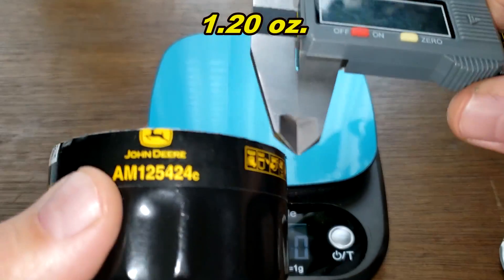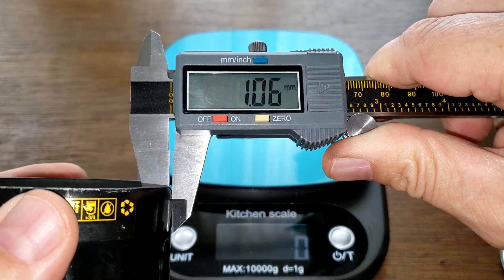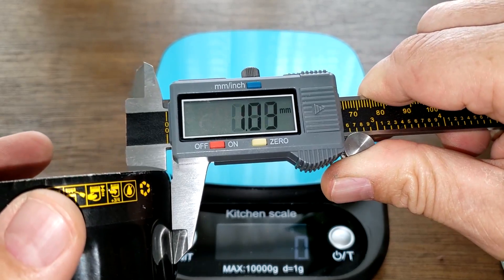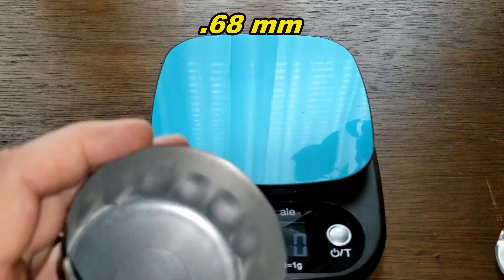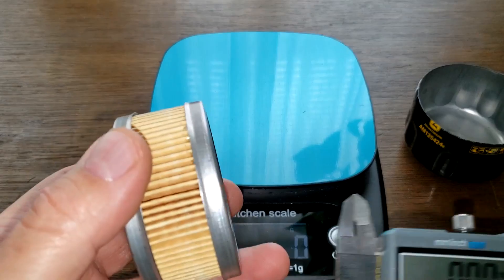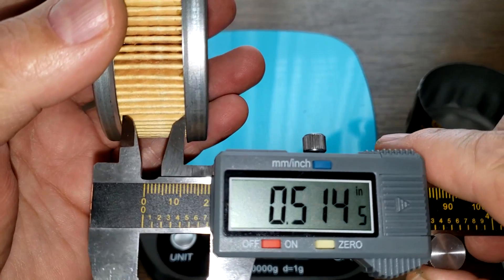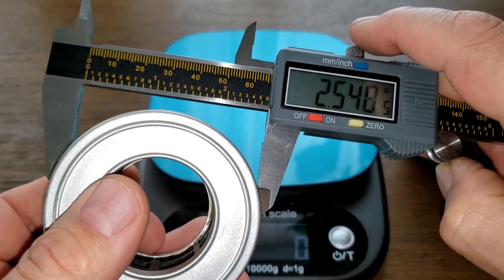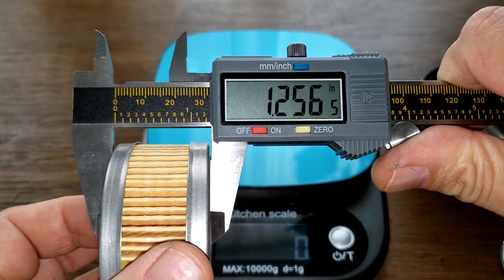Let's get the thickness. This one is a little hard because the can is small and I'm catching the lip. That lip is a little thicker because it's bent over — it reads about 0.68. The can measures 0.738 inches, 2.549 inches, and 1.256 inches.